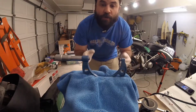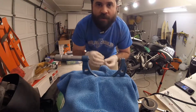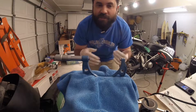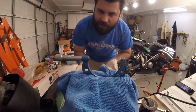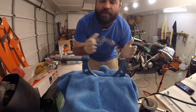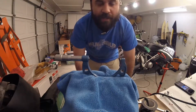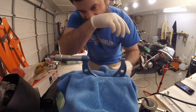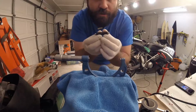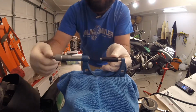Now, outside micrometers typically will come in sets, so you need to pick the tool in the set which corresponds to the measuring range that you're trying to get into. In our case, 2.5998 inches, so I've selected the 2 to 3 inch micrometer. At this point, we can go ahead and check and zero the tool. And by doing so on these larger micrometers, you use these little gauge blocks. So this one is precisely 2 inches.